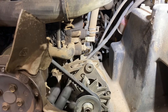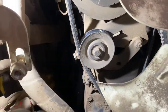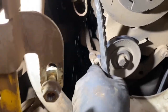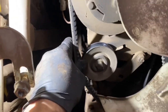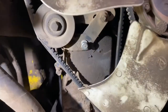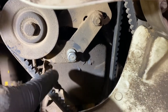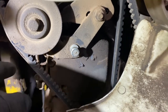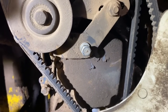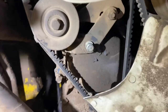Yeah, that's a lot tighter — you probably can't tell by looking at it, but there's a lot more tension on it. This other belt here is very, very loose — I can pull it right off. That's going to need to be tightened, and I believe it's this bolt right here. Well, I found a bolt in the junk bin that just so happens to be the right length, thread, and 13mm. Turns out that bolt had fallen out somewhere along the lines and that was why I was losing tension and getting squeaking. I don't think it was coincidence that I found a bolt in the junk bin that fit perfectly. That is why I pray, people.